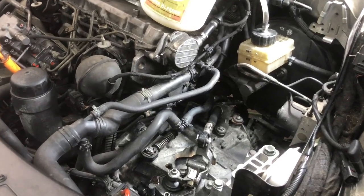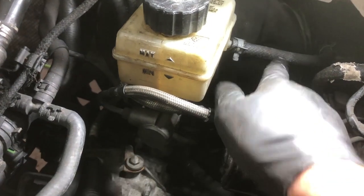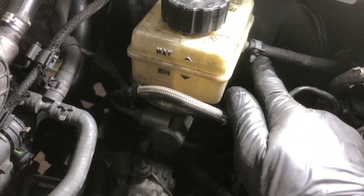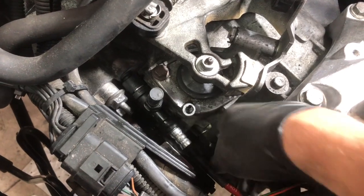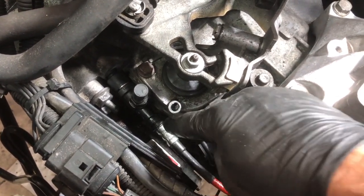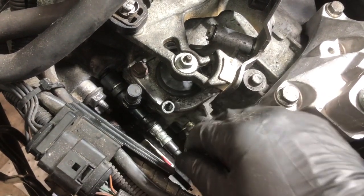The next step we're getting ready to do is bleed the clutch. So I snip the nipple off and quick flip that hose on there before all the brake fluid drained out. Put the clamp on, and my hose is engaged, and I gave it a little tug to make sure it's secure with the clips. I lubricated the little O-ring on the tip of the hose before I shoved it in there so it would go in nicely.